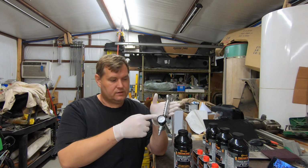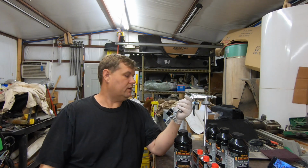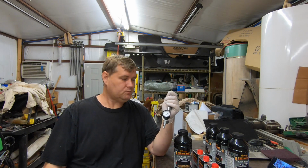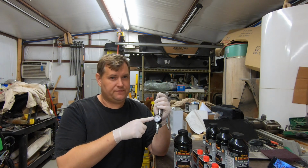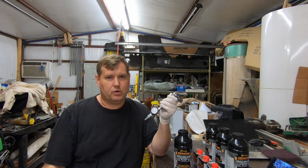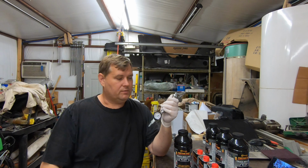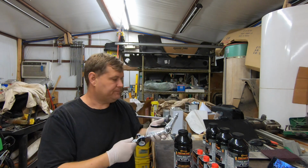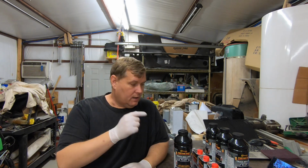And it says to set this little guy, and I decided to use this one that it came with, to between 40 and 60 psi, so I picked 50. Now, remember, when you set one of these type of things, it's not turn the knob and set it to 50. It's pull the trigger and turn the knob and wait till it reads 50, because you want 50 while spraying. I hope you get it. So I'm going to mix this up,